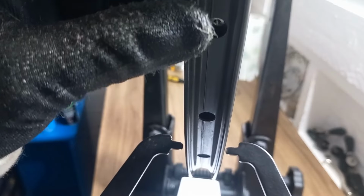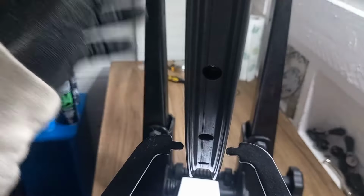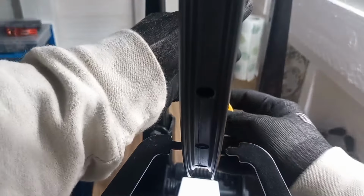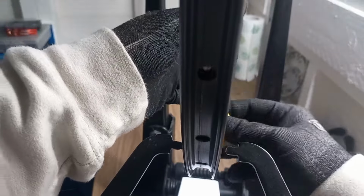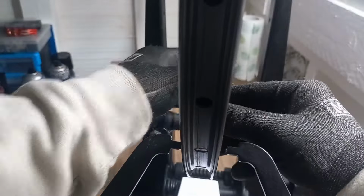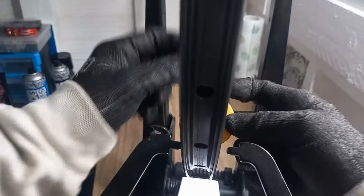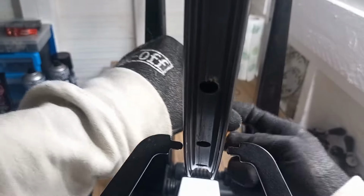See, what you've got to remember, the wheel is still not, there's still a lot of loose spokes on that, so I'm just correcting it ever so slightly before we start getting up to full tension, or well, even remotely close to tension, shall I say. And always bearing in mind that obviously any small adjustments will affect it overall as well.